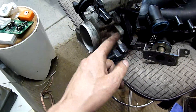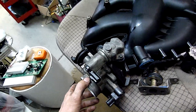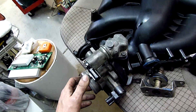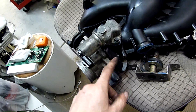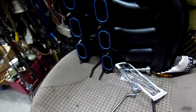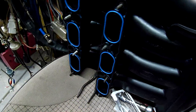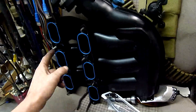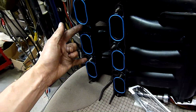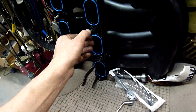Two bolts seems to be the standard - there's no sign of a bolt ever being in the other holes. There's a thick gasket on the throttle body but I'll still take it off, give it another good clean, and make sure that gasket is sealing properly and that there are no cracks around the housing. It's a fairly intricate piece of plastic work - a lot of weld lines and potential places for cracking. But it's odd that the vacuum leak is only affecting two cylinders, not all of them.